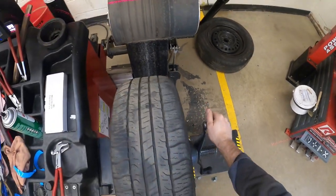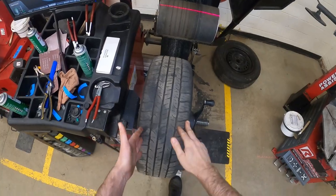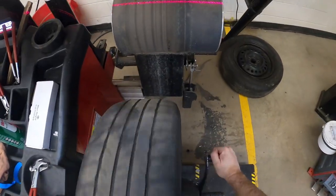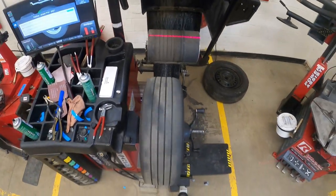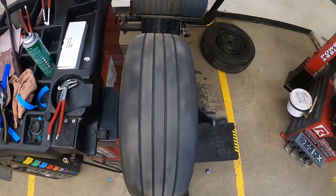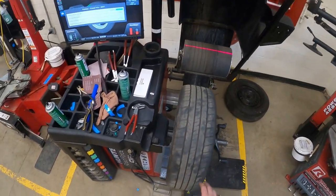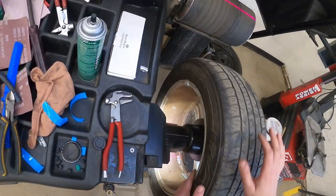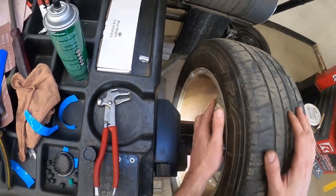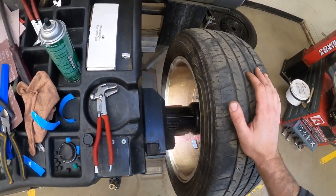This one's a little stiff going on. I like to give it a good brunt hit when I go. I can see this tire in front of me isn't the best one in history, but I'm going to give it a spin and look down the tire to see if it's wobbling from side to side, up and down, or anything. This one's not perfect, and as I look on the side, I can actually see what looks like a weld and some repair damage on this rim.